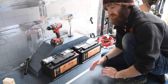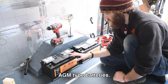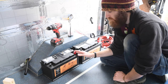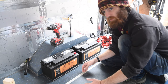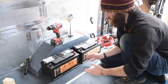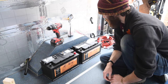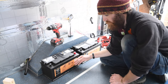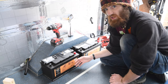I've gone for two 95 amp-hour batteries and I'm going to run those together into a battery bank, which gives about 190 amp-hours of power. With AGM batteries the depth of discharge is about 50%, so I can only use about 95 amp-hours. If you had lithium, you could discharge about 80% of its capacity. These are about 25 kilos each — I've gone for Halfords' own brand batteries, which are a rebranded medium-grade brand and are quite cost effective.